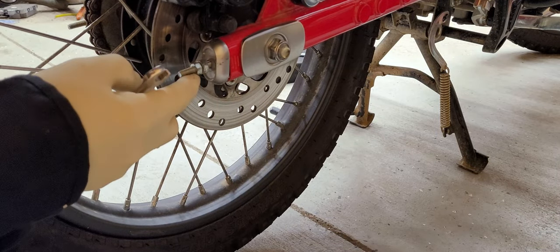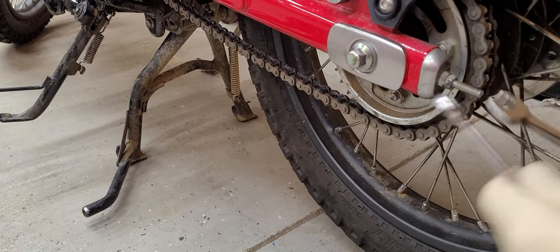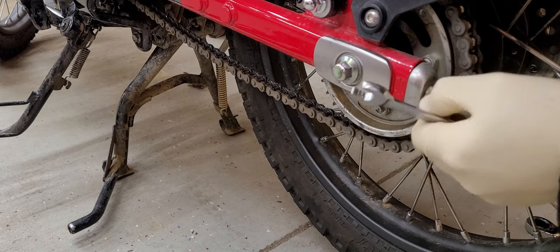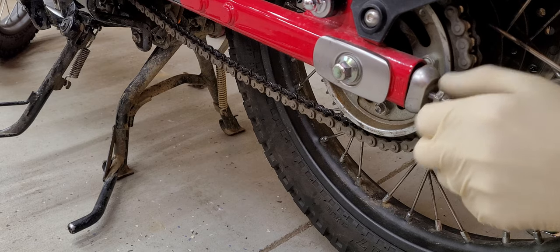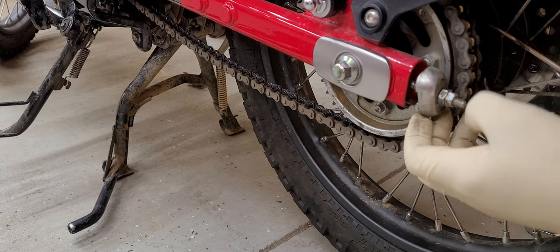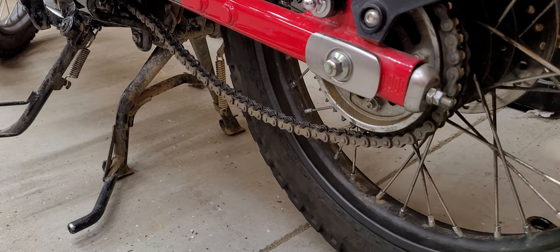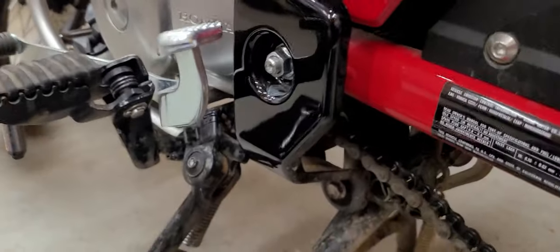Basically the 10 is to keep the 12 from coming back. Give yourself plenty of room. Back those off on both sides. The other side — same way. That one's already loose. I guess that kind of just moves back whenever I loosen that axle shaft. Back that off and get it out of your way. Now when we go back with it, we'll want to make sure these are in the right spot. We can just slide this forward — that's going to give you a ton of slack in your chain, so we can move that front sprocket.